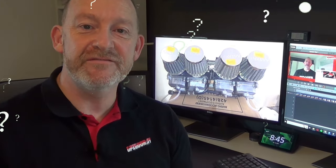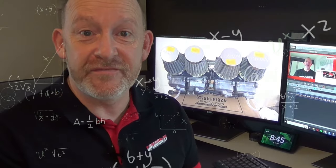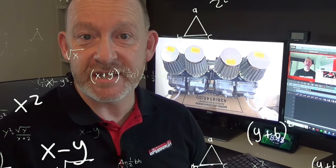So the big problem that we have with pod filters is we don't know the airflow ability — how much air are you getting through these pods? But even if you knew how much it was, that information is no good to us because we don't know the metered airflow; we don't know how much airflow is coming through the original airbox. We just don't have this information. So if you're putting pods on, don't ask the question how to set my carbs up because there is no definite answer.